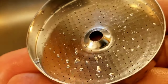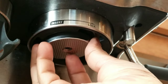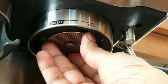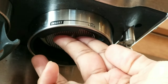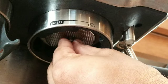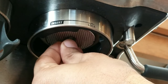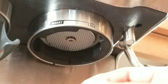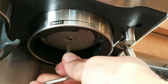Let's put the shower screen back and then run a shot to see. To put back the shower screen, just stick it in, make sure it's aligned properly, and push it up — then you can use the screw to tighten it. It has gone all the way up and should stick on its own — that means you've put it in properly. Tighten it, then use the Allen key to tighten the rest. You don't have to over-tighten it.